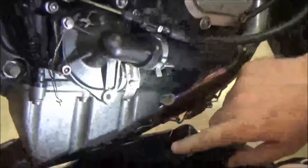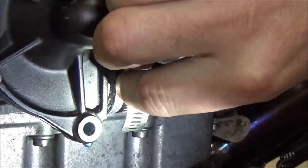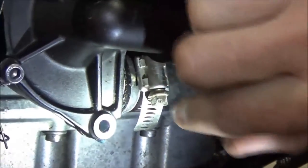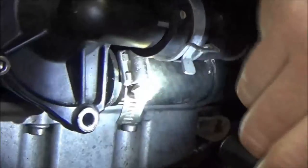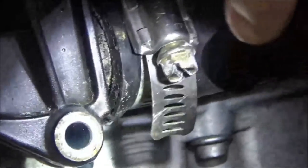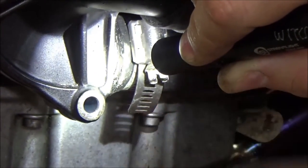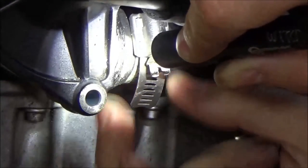This is a metric motorcycle, and the first thing I see is this made-in-the-USA hose clamp — notice how wide it is. It's not that this is impossible to work with, but a lot of people start to over-torque it. Can you see where this is flared up? And do you see that metal tab right there on the housing of the water pump, and how the hose is pinched over it? The problem is this hose is only supposed to go up to that tab, not over it. The hose is actually on too far — this is way too tight and you can see how it's flared up.